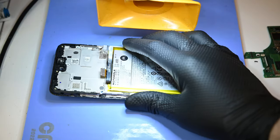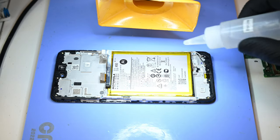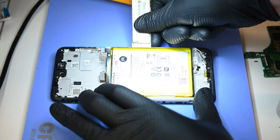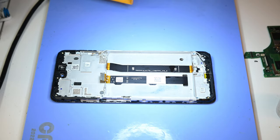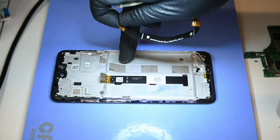Over to the heating mat to soften the battery adhesive — a few minutes at 60 degrees Celsius and a healthy bit of alcohol should weaken the semi-permanent adhesive. While most people will tell you not to use a metal pry tool to remove the battery and opt for plastic instead, I'm not here to enforce any rules. I'm just some guy on YouTube who passed 5,000 subscribers — thanks for that. That main sub ribbon sandwiched below the battery can now be pulled away.